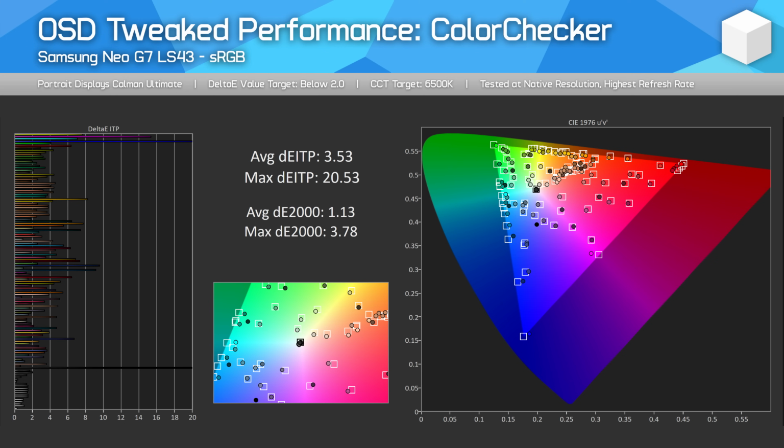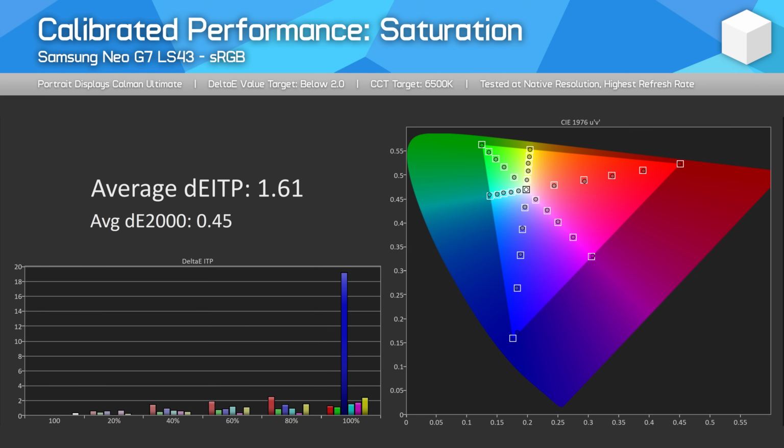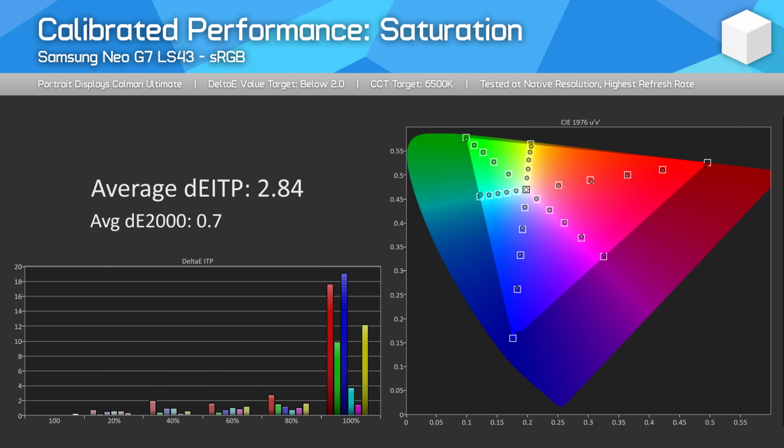on this monitor. A full calibration in CalMan to create an ICC profile then provides minor improvements from here and doesn't require the use of the shadow detail setting, so we can maintain the high native contrast ratio and get accurate gamma at the same time. P3 calibrated performance is okay, not full coverage, but decent enough.